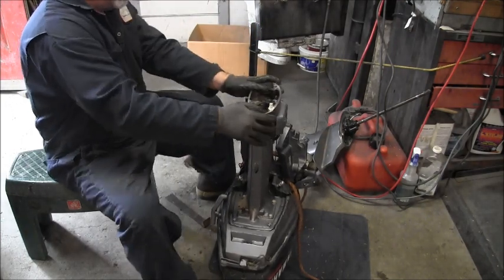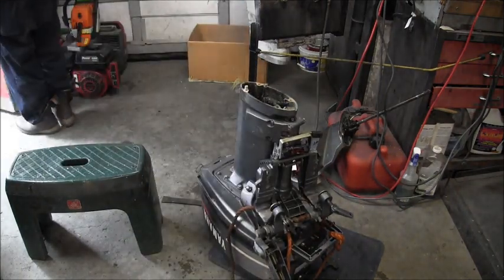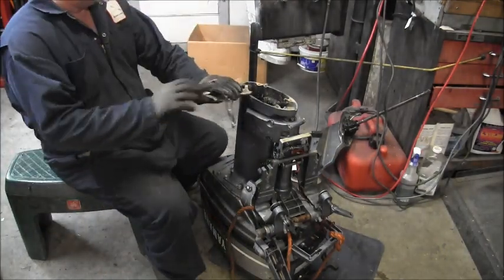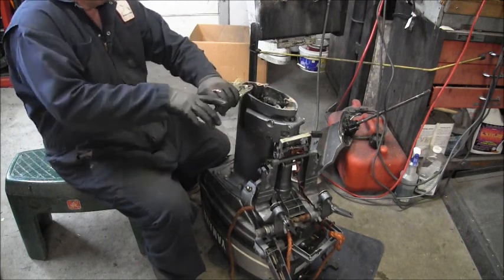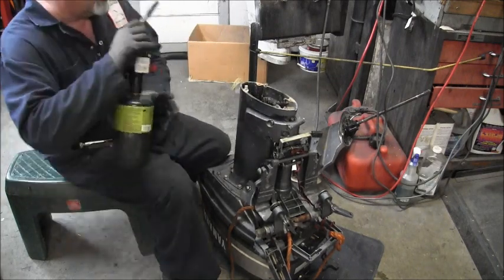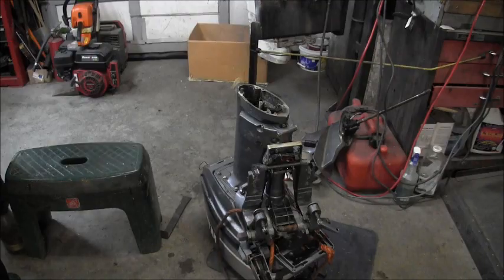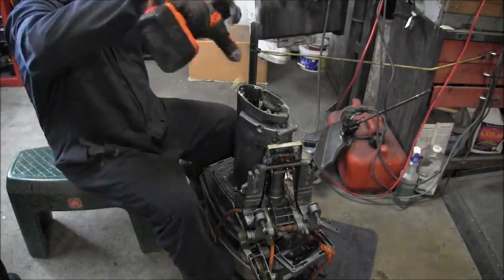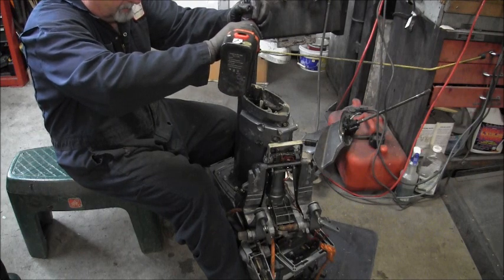First, I got to get this off. First, we got to get that stud out. Look how white and salty that stud is. White and salty. Okay. There we go. What we'll do, since it's being a toughie, I'm going to drill right down beside the bolt, in toward the bolt, with a little teeny drill bit.